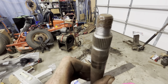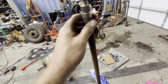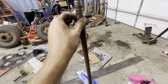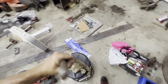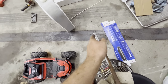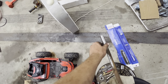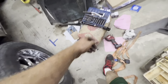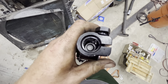The stock steering shaft — I cut it off the gearbox. I started unthreading it and could almost get it out, but then it stopped. I think you have to take a part off for it to unthread all the way out, but I don't need all that anyway so I just cut it off. This is that intermediate shaft that goes inside the column and goes around the shaft. I started sanding it just a little bit with 320 and it came out really clean, really quickly — just like two seconds of sanding. This is just wrap sanding and I'm going to go ahead and sand the whole thing.